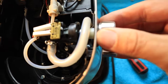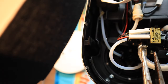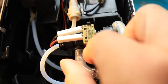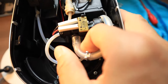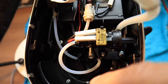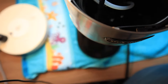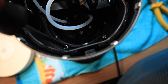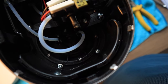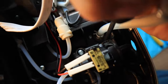First things first, we have to remove the steam knob — just pull that right off. And I would suggest removing this hose here with your needle nose pliers. You can loosen the clip and wiggle this hose off here. Now we have to get these screws here around the group head. Let's start with this one here on the left. Number two at the front of the group head. Number three at the front of the group head. Then we've got a screw near the steam dial, and another screw holding it down on the other side.